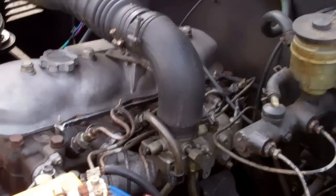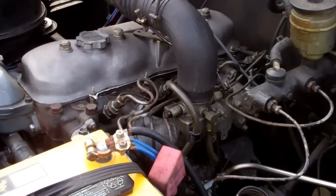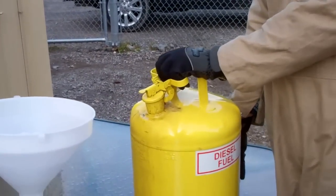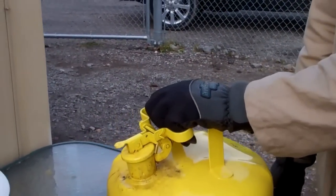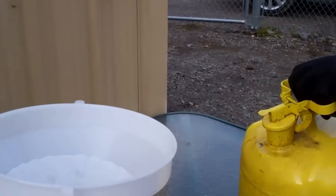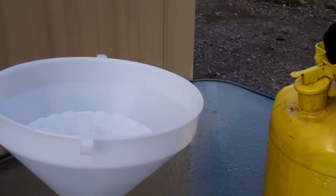The vehicle originally came with a 2B engine and we replaced it with a 3B. There's no emission control or anything on it. This is an experiment to run the Land Cruiser on a Sentara S20 blend of 80% gas station purchased diesel fuel and 20% Sentara production from November 10, 2012, made from wood chips in Toledo, Ohio.